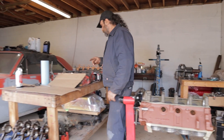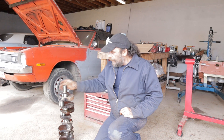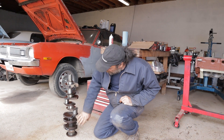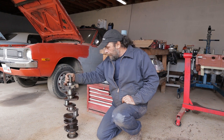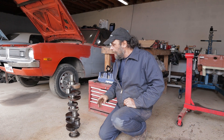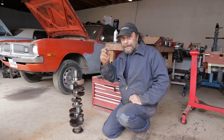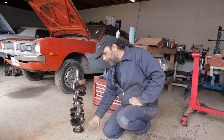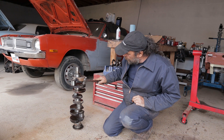Now the parts that are going in it. First is the crankshaft — this one came out of a motor we pulled. It's intact, no obviously spun or destroyed journals, but you still don't know the quality of it. Here's what you need to know: a crankshaft is essentially a spring. To see the quality of the metal and how much life is left in it, you want to give it a ring test. Put it on a hard surface like concrete, take a small hammer, and just tap on the counterweights.